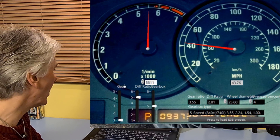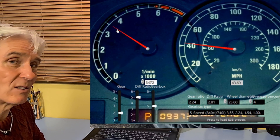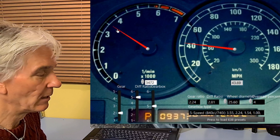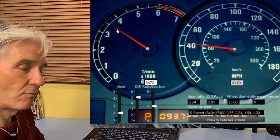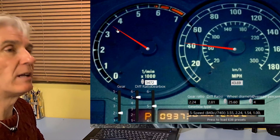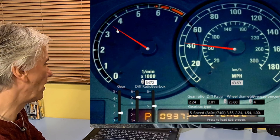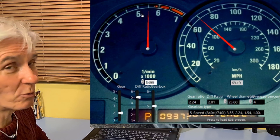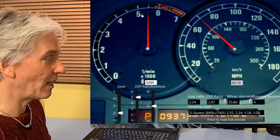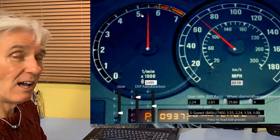We remember 43 mph, change into second gear, drop back to 43 - that's 3,500 RPM. For the M62 we're still in the power band; for the M60, a bit out of the power band at 3,500, pretty feeble - reach 4,000 and the power all comes back in. In second gear at 5,500 RPM we're doing 70 miles an hour. It's pretty impressive, but this is also the same reason why the 840s accelerate so badly - such tall gears. We're talking second gear and 70 miles an hour. That's absolutely crazy.